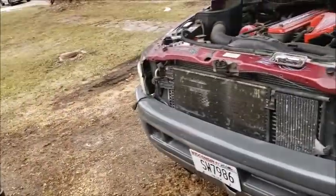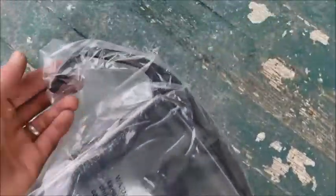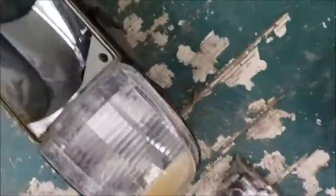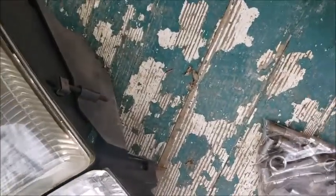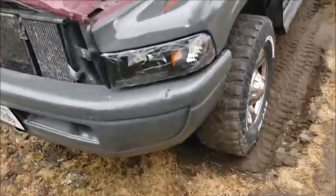Alright, so what we're doing today is putting in headlights. Got that one in — it's pretty simple. It's just three bolts: one here at the bottom of the front of the light, there's a little plastic clip that holds this thing on, one here, and one up there in that hole. We got the old one out and yeah, these things needed to be replaced. There was a bunch of broken glass pieces in there. These headlights aren't much good anymore, so they're probably just gonna get tossed in the garbage. But we got one on that looks really, really nice.